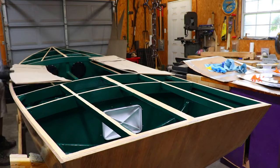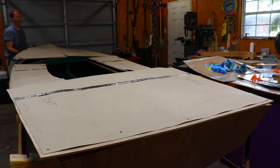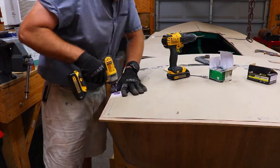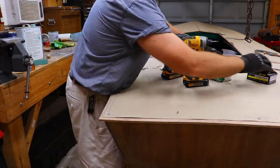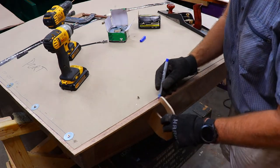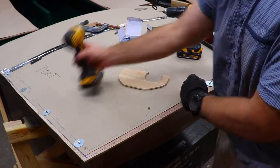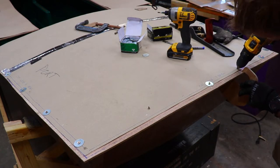I can then place the five deck pieces back on the boat. I cut these wider than the patterns because the edges are going to need to be beveled where they meet the sides. I then start to install the deck panels by marking and attaching the screws that I'll use to clamp the deck down onto the deck work when I'm epoxying it in place. I use a scribing tool to mark where the edge of the deck is going to be after it's beveled, and then I measure inboard from that to the center line of the frames where the screws are going to be. Then I use the same tool to align my drill bit parallel with the sides of the boat to drill the holes for the screws.